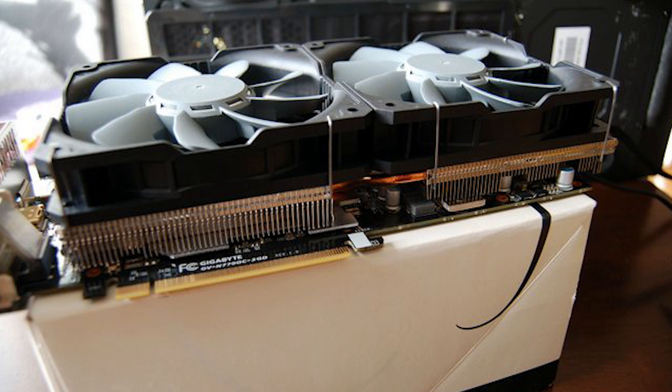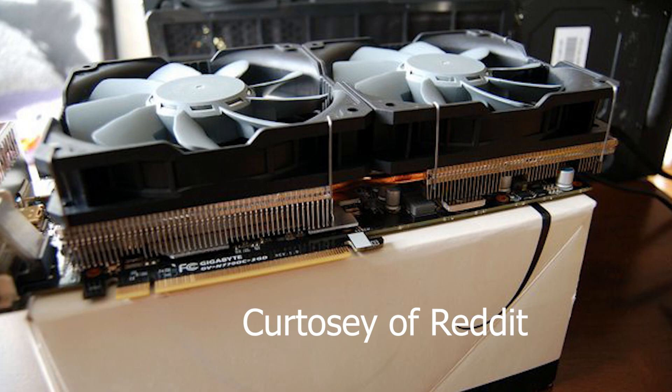There are a couple different options. One of them is just ripping the fan shroud off and zip-tying some regular 120mm fans to the cooler to get it up and running again. Or, of course, doing something like liquid immersion, which is a much larger scale since you'll need bins, liquid, and all the plumbing. Bitsby Trippin is actually working on that right now, so go check his channel out if you want to see what he's doing with his mining farm.